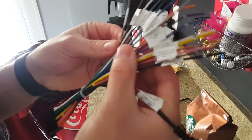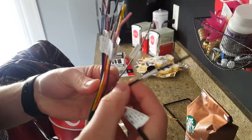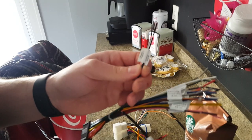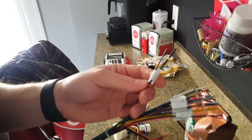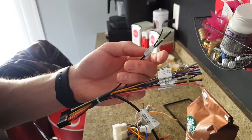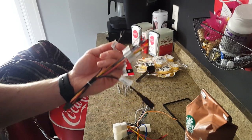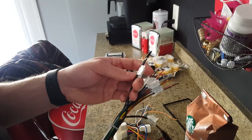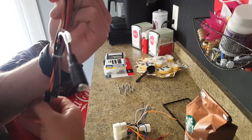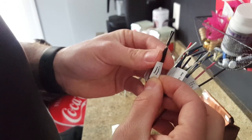On this radio there is a parking brake wire. Rather than wiring that to the actual parking brake — which is complicated and time consuming — we don't really want that functionality anyway. One of the most annoying things in my FRS is that Bluetooth can only be switched over if you're not moving, so passengers can't even connect their phone. I also like to listen to YouTube podcasts while driving. To bypass this, you take your parking brake wire and your chassis ground, twist those two together, and that will simulate the parking brake being on at all times.